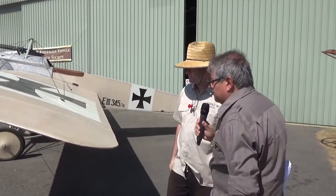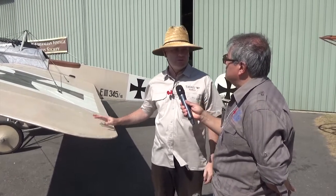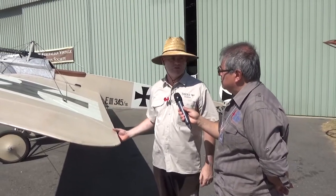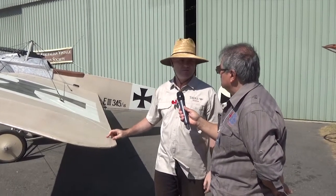What's the finish? How many layers of dope do you have in this? Because this will spit out a lot of oil, I would imagine. It does. So initially we probably didn't have enough dope on it — we went very, very light on the dope, and we found that these fabric tapes underneath started soaking up all the oil. So we replaced the tapes and put more layers of dope on. You're looking at probably eight to ten layers of dope all up.